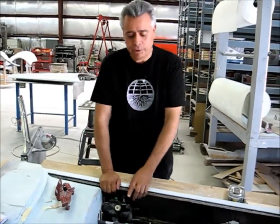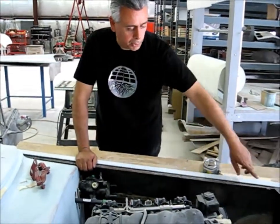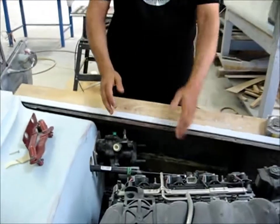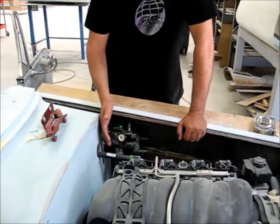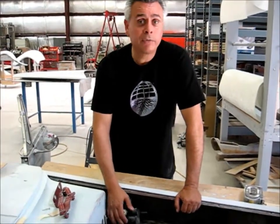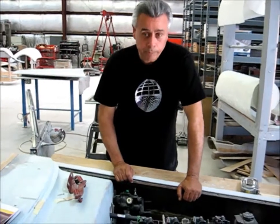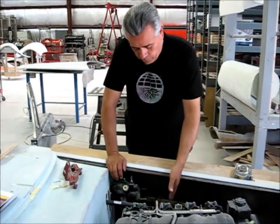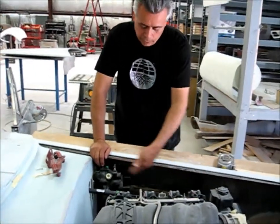But the unique thing about it is it's not vacuumed at all. In other words, it's not hooked up to the vacuum system. It's hooked up to our power steering pump and also our power steering rack. So this little thing here, in case the power steering and the engine shut off, this would still stop you at least 3 times with the braking, as the manufacturer tells us. And this is a very unique unit, very expensive unit, I might add. Bosch makes this unit, and it's typically not found on cars because of the expense of it. So we've gone out of our way to not only stop the car, but make it more convenient, and it actually looks real good in there and fit perfectly. There's another piece that comes out here where you put your oil into it, which is not on here right now because we're still prototyping it, but it was on here and taken off.